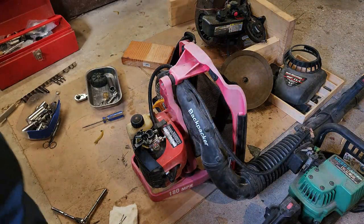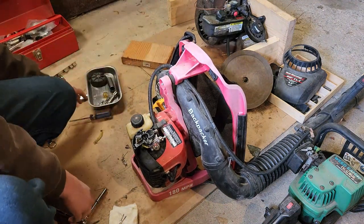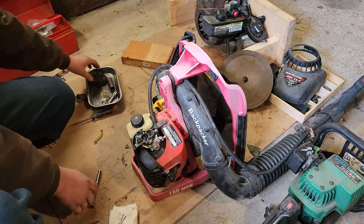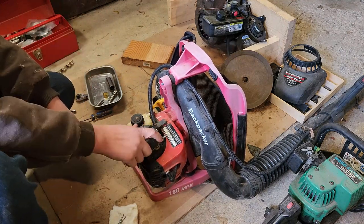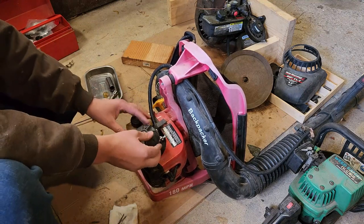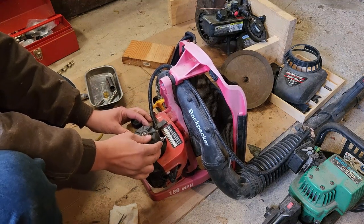Alright, I put this dumb thing back together. Actually, it's not the machine's fault. Definitely my fault. But, oh well. You win some, you lose some. Okay, got our top on, full choke, have fuel, spark plugs connected. Primer, wouldn't you know, it works when you plumb it the correct direction. How crazy is that?